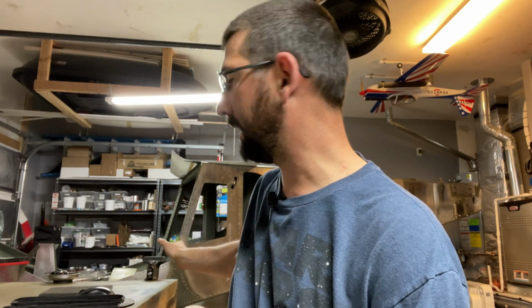So like I was mentioning, we did the gear, I did the same thing. I went ahead and sprayed the primer, and then as soon as it started to get tacky, I went ahead and sprayed the base coat. I think I did 3 coats of the black on top of that 1 coat of primer. Worked out really well. It sticks very, very well.